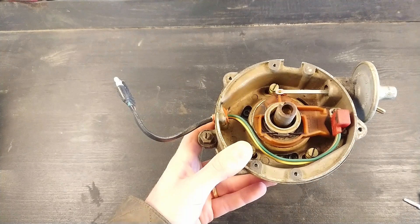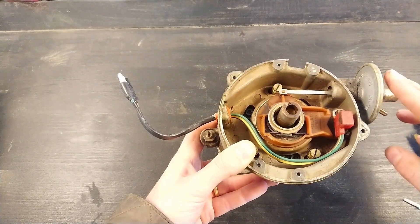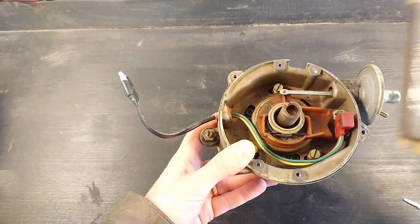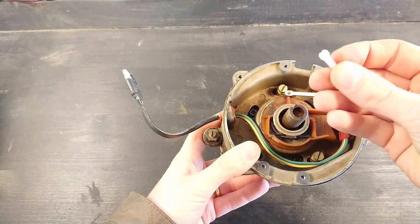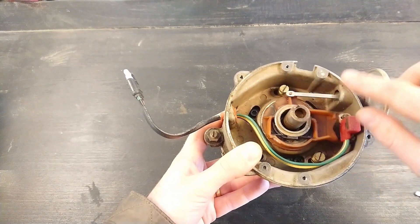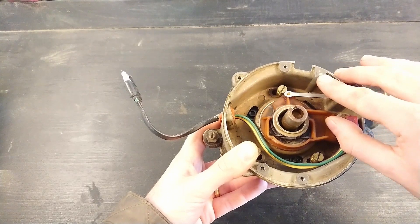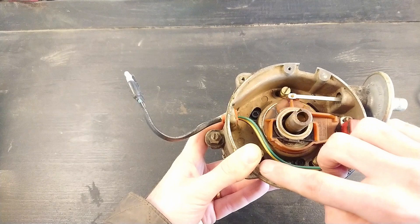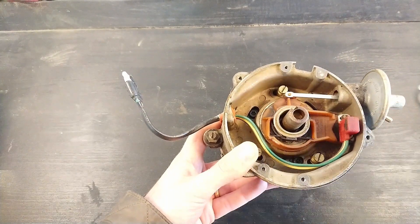Here's the distributor with the rotor removed, the trigger wheel for the ignition, and the old trigger board has been removed as well. If you need to know how to get the distributor out, I've already made a video on this — I'll put a link up above and below. Getting the board out is really not that difficult. You just need to remove these little screws. However, they are little plastic or nylon screws, and I'm willing to bet that they're going to snap off because they're really not that strong. With all the heat over the years they just get stuck in there, so you need to drill them out with a small tiny drill. Then clean up the threads or re-tap them — that's what I've done with these two. Now I'm going to do the last one and chase the threads with a bolt that has the same threads.